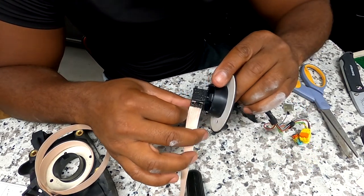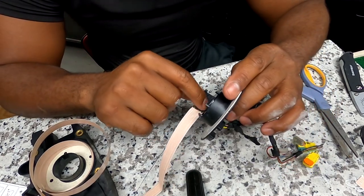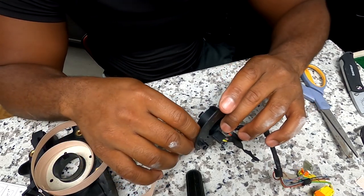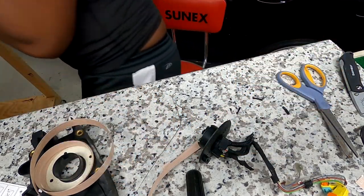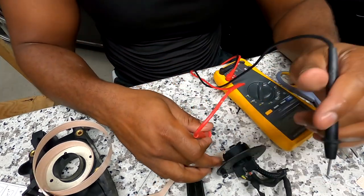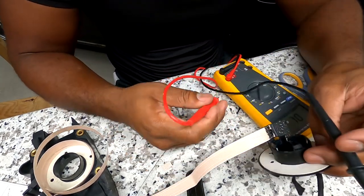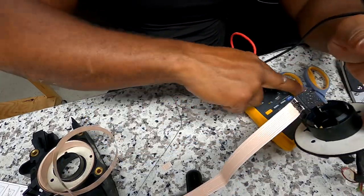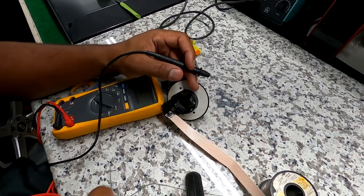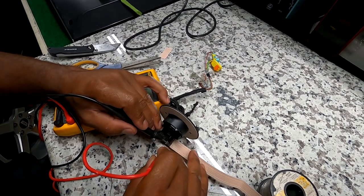Man, I'm trying to check my errors right now. I melted a lot of the plastic from the backside when I was trying to clear this out. But I think I got it clear with no shorts. I'm gonna get my meter and test point to point. Continuity check. And I'm gonna go right here where I can see my clean breaks at and touch from pin to pin. Let's see if I can get y'all in a better spot. One more, 4%, man. The battery about to die. But let's look, point to point.